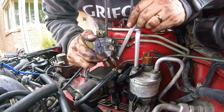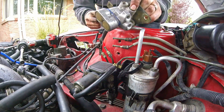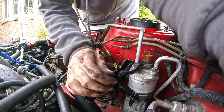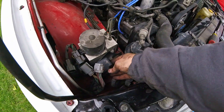Now we're going to come in and pull that guy off. I'm also going to take this guy off at the same time, just because I don't want it anymore. I pulled off all these connectors, started the car back up and they didn't do anything — no check engine lights. So if you think removing the ABS is going to throw a code or anything, don't worry about it. As many wires and things that plug into it, it seems like it should have more of an impact on the rest of the ECU, but it doesn't. Feel free to unplug it and remove it.